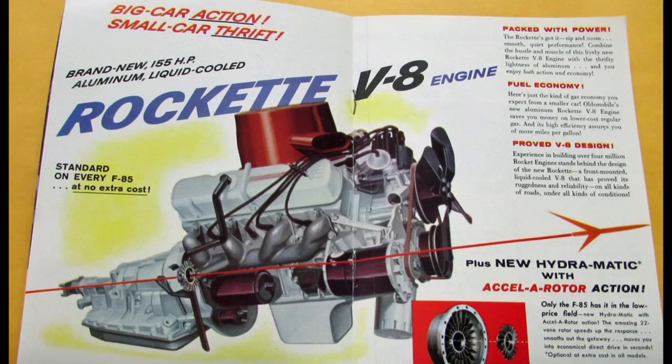In any case, let's take a ride with Mark in his F85. You can experience the 1-2 shift, and also one good thing I can say about these transmissions was that in third gear they did have a 60% mechanical lockup, so they were relatively efficient.